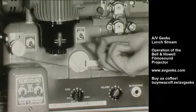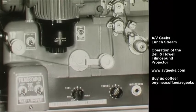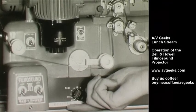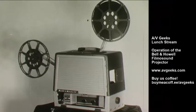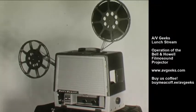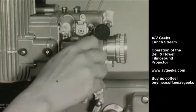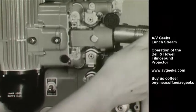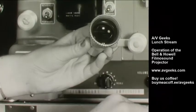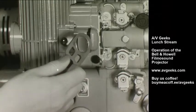To show silent films, the sound silence switch should be at the silent position, and the amplifier switch should be off. Otherwise, the projection procedure is the same. We've seen how to operate the Bell and Howell projector. Let's now learn what care and cleaning should be given the projector. Pull out the projection lens and clean it with lens tissue when dusty. The condensers may be cleaned in a similar fashion.